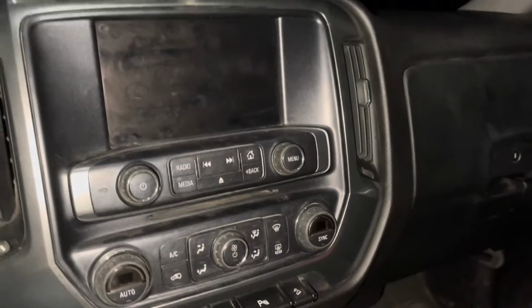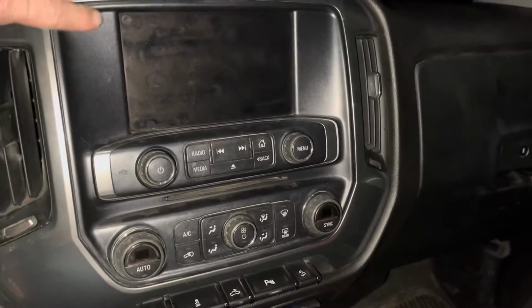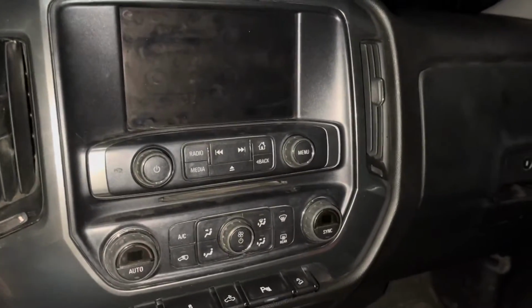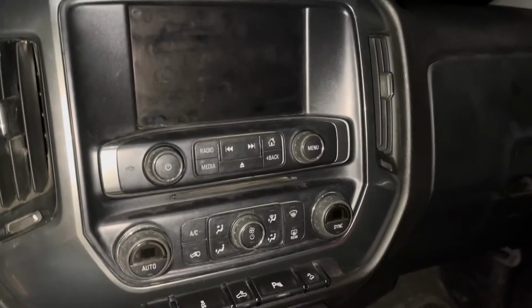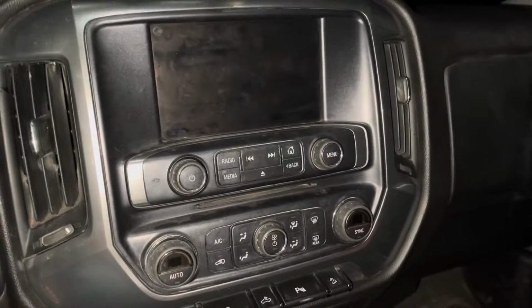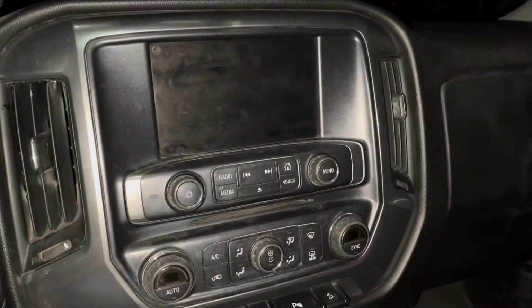Okay, so on the back side of the radio, on the factory plug, the wire colors that you're going to look for, if you use the same line out converter that I'm going to put in the description, are: blue is your left positive, your brown and blue is going to be your negative left, your yellow is going to be your right positive, and your yellow with a black tracer is going to be your negative on the right side, okay?